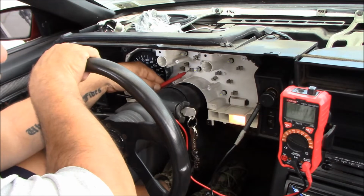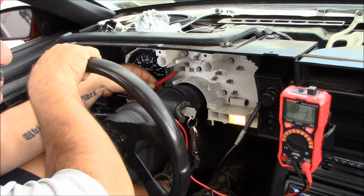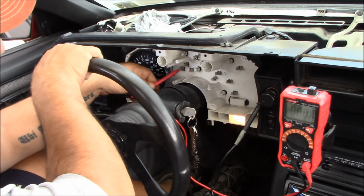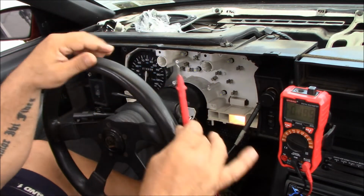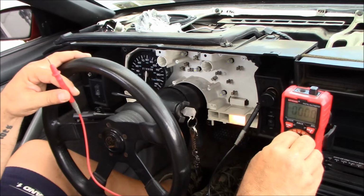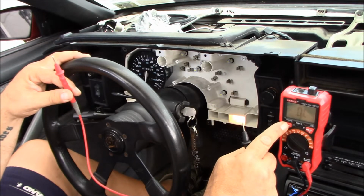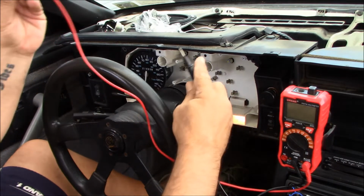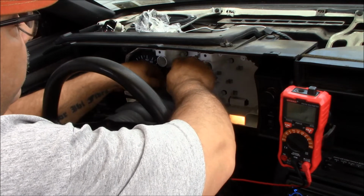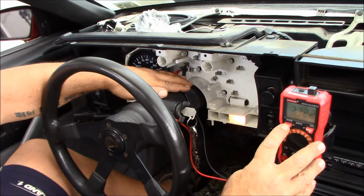So now moving to the temperature gauge, there's my battery voltage one, and then my other two again are 2.5 millivolts and 4.3 millivolts. So again, I think my 2.5 millivolts is going to be my ground. I'm not an expert at all in this electrical stuff, but what I do know is that now that I've identified those two circuits, I can go to ohms, okay? And what I want is to know how many ohms is on those two millivolt voltages coming out of my temperature gauge. And right, I'm getting this ohm reading here.